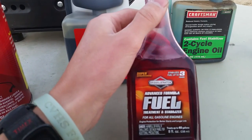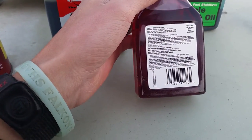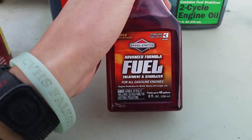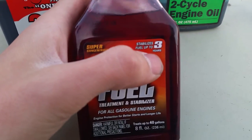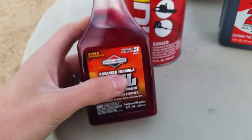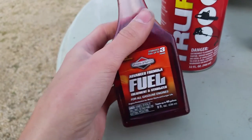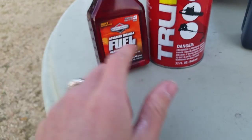I'm not saying ethanol's a bad thing — I've got a go-kart that runs on ethanol, and another engine I use for a generator that also runs off ethanol exclusively, E85, and there's no problem with it because it's designed around E85. These really aren't. So when it comes to fuel that's got a lot of ethanol in it, such as E10 or E15, they don't really agree with it after a certain time period. I actually prefer this Briggs & Stratton stabilizer over Stabil, because this is much more concentrated and it lasts up to three years, versus Stabil which only lasts to maybe one year. So I'd definitely go with the Briggs & Stratton fuel stabilizer if you can find it. If you can't, Stabil works just as well, it just won't last as long.